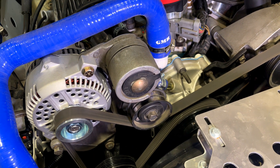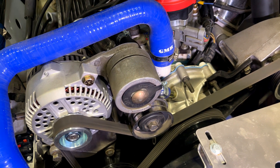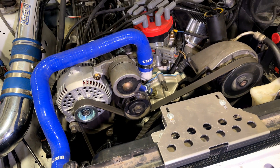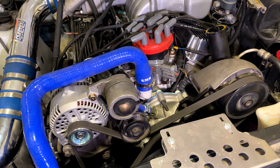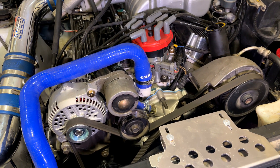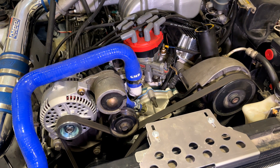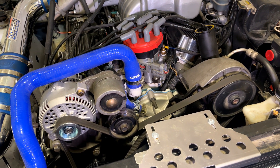You need to get the car set to the normal setting, which is 10 degrees before top dead center. If it's done with a performance chip, that's almost always the right setting. If you have no chip in the car, you can bump it up between two and four degrees — it'll help a little bit with performance, and that's part of the 10-minute tune-up.